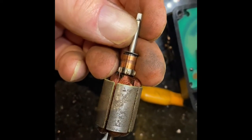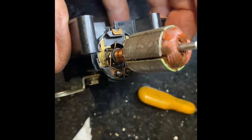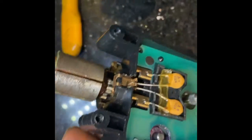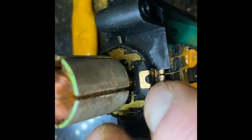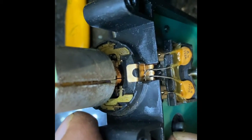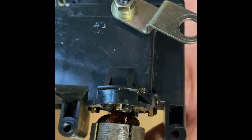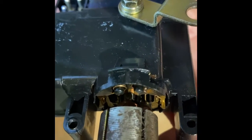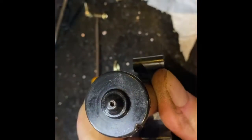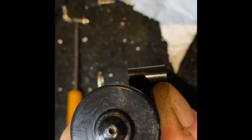Cleaned up the motor and took the rust off. Now I'll try to reinsert it — I'm putting it in without the casing because that allows me to get the brushes back into place. Those two small springs on the brushes — that one and that one — have to go in that position on top of those little brass prongs. The end of the motor as it goes into that union has to engage in a slot, so you need to be careful that it engages, and you can feel that from the lever. The next issue was to persuade the spindle to go through the support hole at the end of the casing.